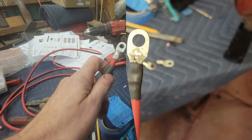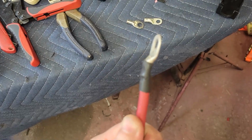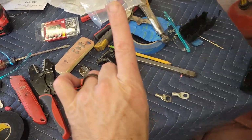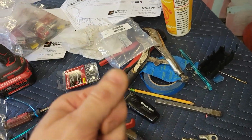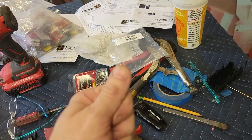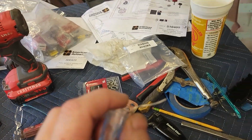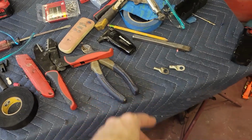So yeah, I'm going to go ahead and solder that now. Well, my phone died as I was recording it, but that's how it came out. You can see the soldered end is underneath the shrink wrap, and to do that I used a little mini butane torch and some electrical solder. I heated it up with the torch. The flux is already in it. I made sure that the little ferrule was upside down so that the solder, even though the flux should draw it into itself as you heat it, you need to heat up the fitting and the wire. So you're heating the fitting after it's crimped until the wire gets hot, and then you make sure that the wire you're heating through the fitting is hot enough that when you touch the solder to it, it melts and it'll draw it into that part. So I'll see if I can find another opportunity to do that, but let me continue on.